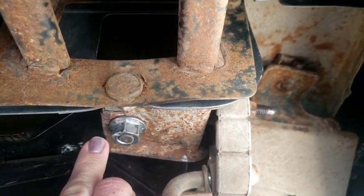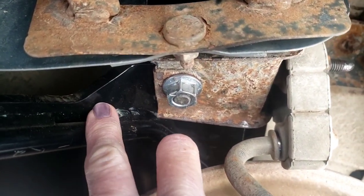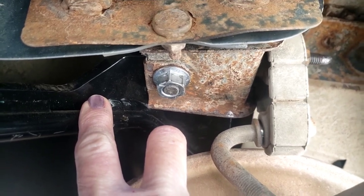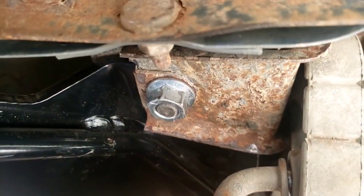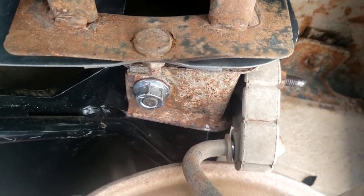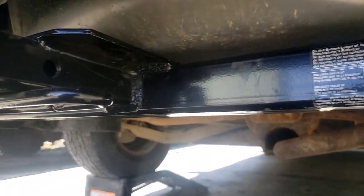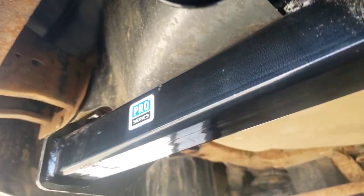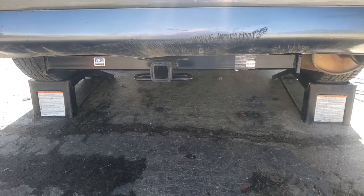The exhaust bracket for the muffler was a little tricky — it stuck out another two to three inches in an L-shape, so we zipped it off blunt with the angle grinder and cutting blade. This is the new hitch — now I can use my car a little less like a truck and haul some nice loads. We're off to work on our next project, everybody — see you next time, thanks for watching!